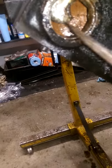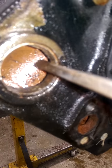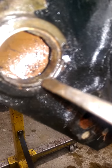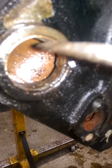Get it to the point where the metal is very malleable, very bendable. That center part just came out - I'm left with just the lip inside the bore, just the outer part. Now the part you want to be careful of is obviously the piston jacket behind there, so you don't want to miss and come into the piston jacket. That center part - that's the integrity of it. Once you've got that out, you can work on this lip.